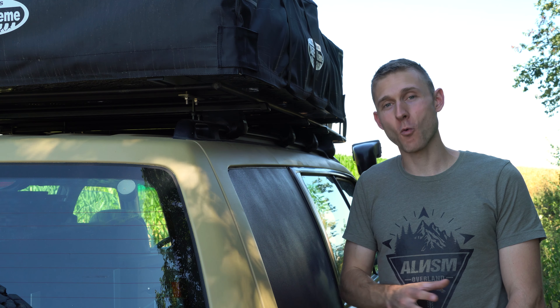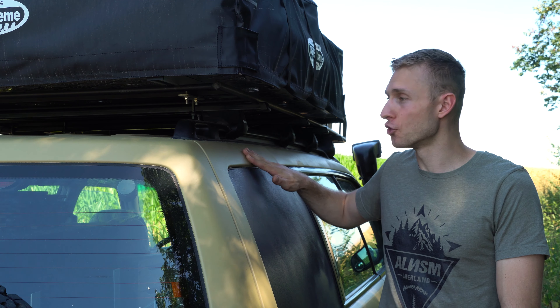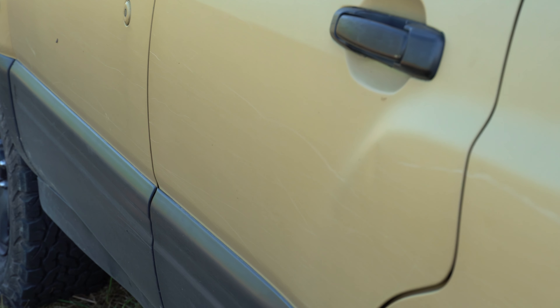And finally, the question you're all waiting for and I get asked a lot: how's the paint holding up after all these years? Well, after three years of intensive use — you saw that in my videos — I can tell you the paint is holding up very well. High pressure washer, mud, ice, narrow trails with a lot of branches — this is not a problem. The paint is still looking strong and good and I really love it. But there are still two things from my experience you have to know. First is the extra care around the windowsills. I told you to put extra time and effort there — because I didn't, and it resulted in the paint splitting off. That's totally because of bad preparation before paint application — I should have sanded and cleaned it more.